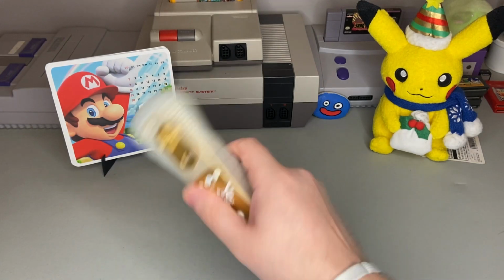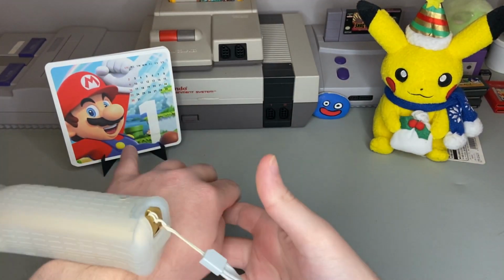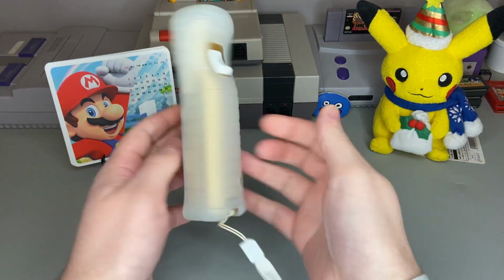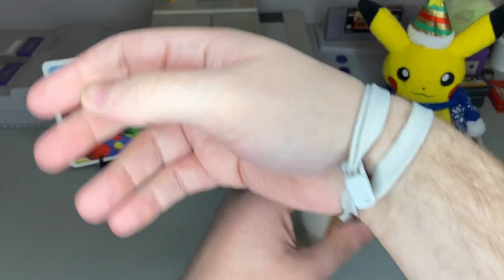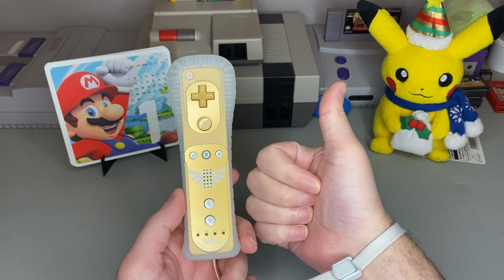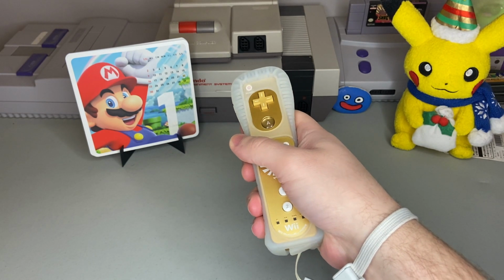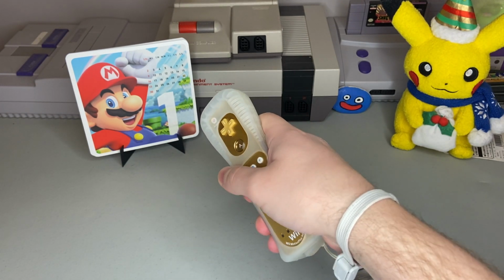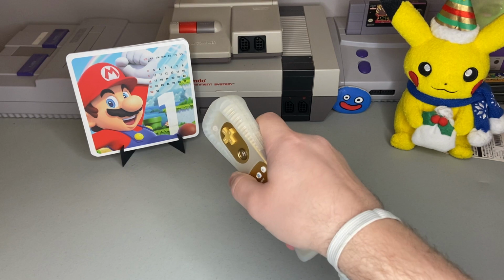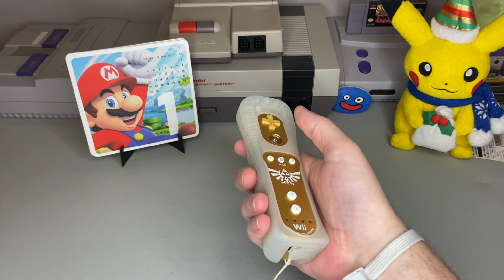First, we have the issue that a typical gyro sensor was not accurate enough to read very fast movements. This was solved by simply increasing the number of degrees per second the Wii MotionPlus can discern. In case you're wondering, that's 1600 degrees per second. However, this led to a different issue where the gyro sensor was too accurate to read slow movements. This was addressed by adding a separate mode to the gyro sensor, where it essentially truncates some of its data to better represent slow movements.